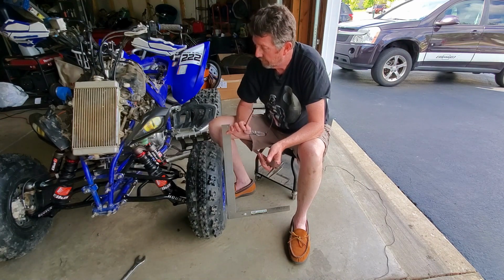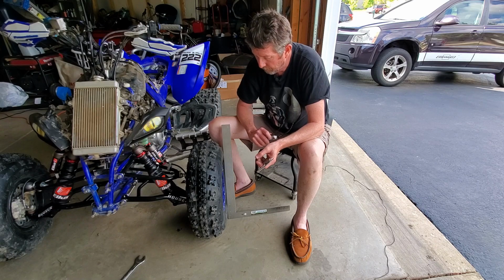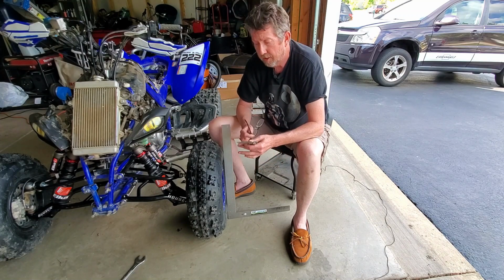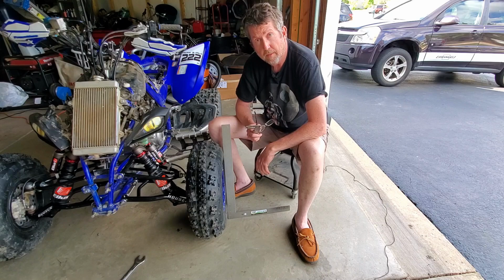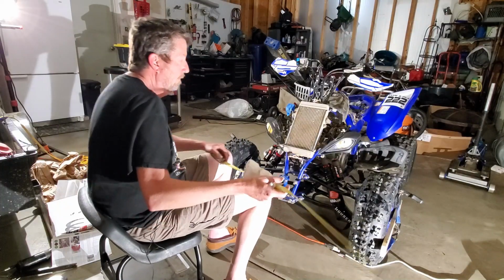I'm going to go ahead and start off there. I thought about doing 1. I'm going to go ahead and just start off with 2. I struggle with the corners, so I think that's going to help me. So that's it. That's how you do your camber adjustment, which is the bow in and out. Next thing we need to do on the list here is to adjust our toe in. So let's get set up for that. Okay, folks.